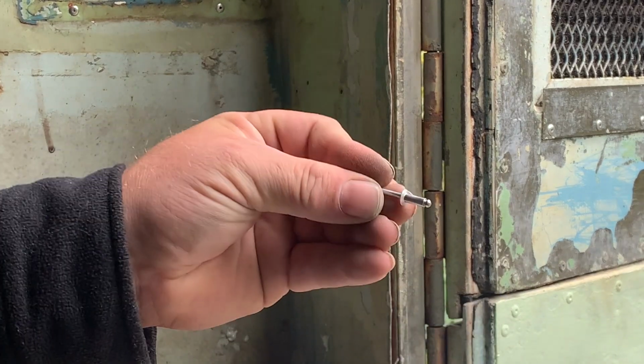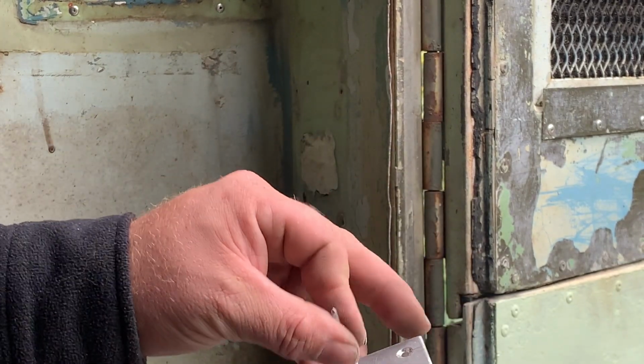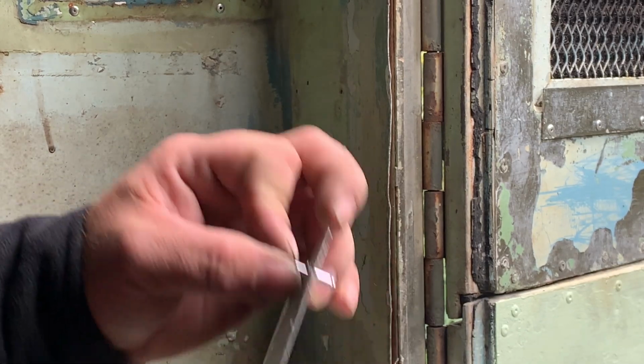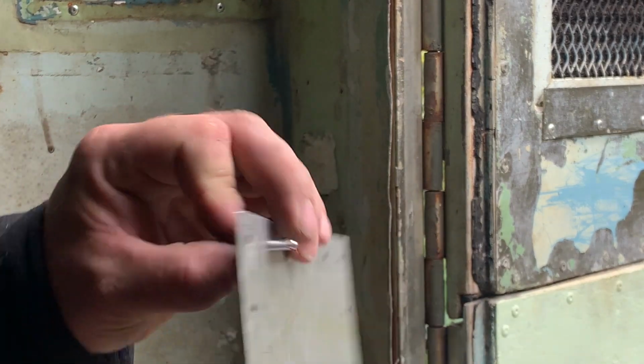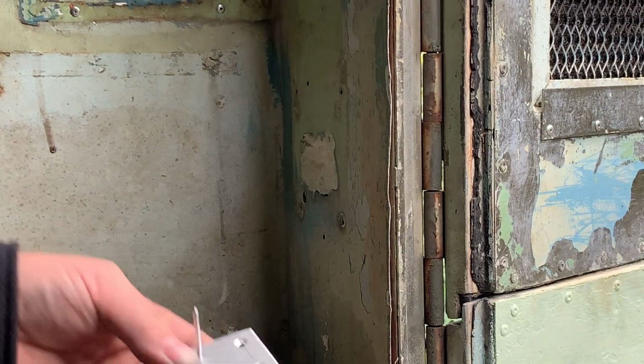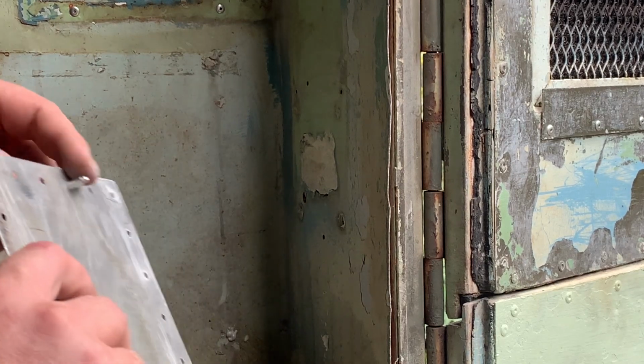Because if you have a patch that's thicker than this rivet, then there's no need to countersink it all the way down to the cross section of the patch, because then your rivet will just be completely countersunk. It's unnecessary work. Anyways, I think that's just being a grammar Nazi about the wording. And there's no reason for that up here in the holler.